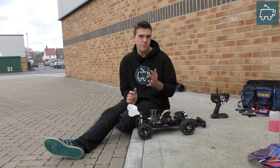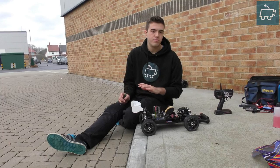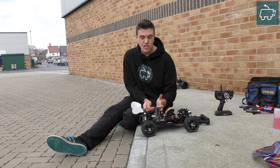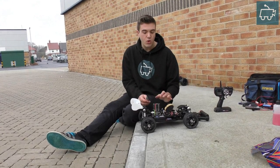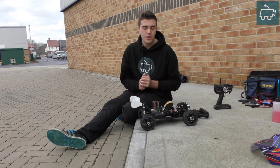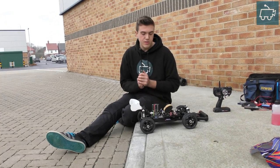So let's start by saying: what does rich and lean mean? Lean means your engine is running with more air and less fuel. Rich means it's running with more fuel and less air. Out of the two, it's better to run with more fuel for obvious reasons — these engines don't have a sump, they rely on the fuel going in to lubricate them. Having adequate fuel is absolutely vital for engine temperature, engine wear, and engine life. If you run an engine lean, it's going to blow up in no time at all.